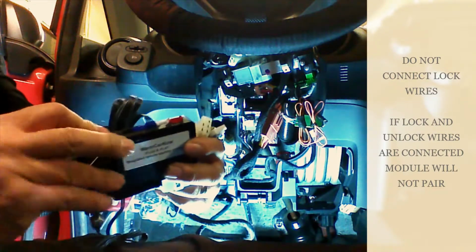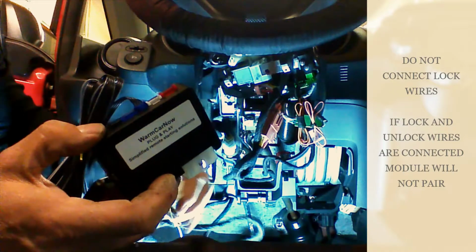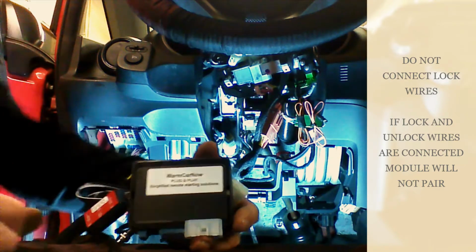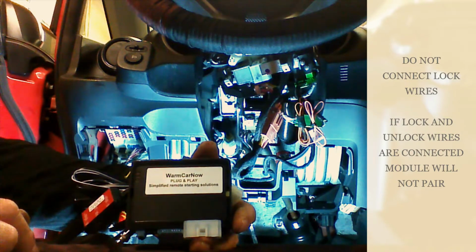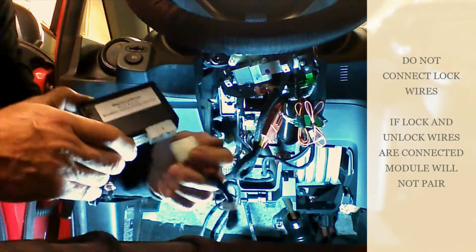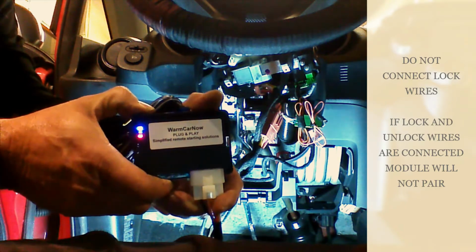We're going to locate the program button on the top of the Evo. We're going to hold this button with our thumb while we plug in our 6-pin power plug. We do this, the 3 lights on the front are going to begin to cycle. There's 3 colors: a red, a yellow, and a blue. So we want to release on a solid red light. So I'm going to give you a little example here of what happens when you hold the button and you plug in the plug. Like I said, the lights will begin cycling. We want to release on red.